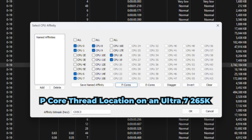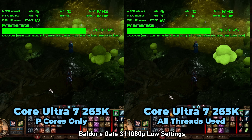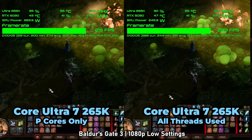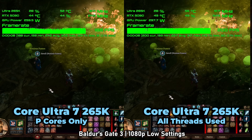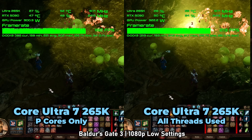When testing core affinity, the Core Ultra series layout is all over the place — as you can see in this Process Lasso illustration on screen, the P-cores are scattered in different locations rather than grouped together. Process Lasso identifies P-cores immediately, saving frustration. However, I found that disabling E-cores actually lowers performance on the Ultra series — the E-cores need to stay on at all times.